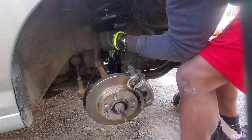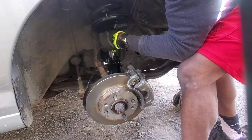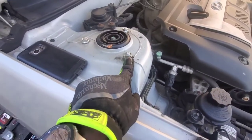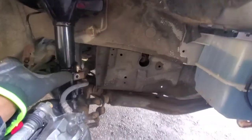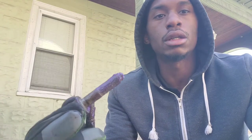Now we're going to put our bolts in to keep it in place — don't have to tighten down yet. Our bolts are started. These are actually 15s on the new bolts; all the old ones were 14s, so we had to change up our measurements. We must get these back into place. As stated, we greased them up first because we didn't get any new bolts, so we'll use these again — a little grease makes it easier.